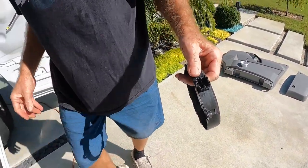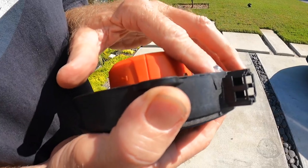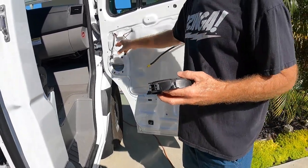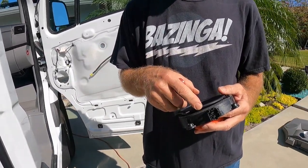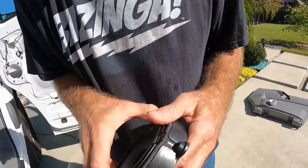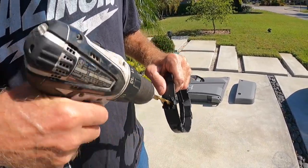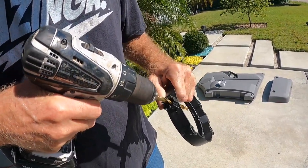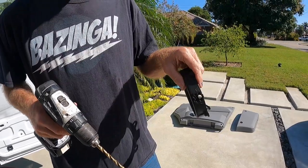When I put my new speaker in here, it's going to fit something like this. I need to get my wire up through here so I can connect into my other wire. That's going to be where my crossover gets mounted. One line goes through the woofer, one line gets fed through here and up through the tweeter in the dash. So for now I need to make a hole in here, and that should be good enough to run my wire through.